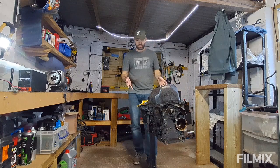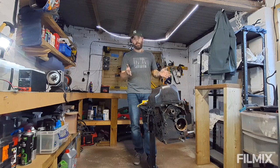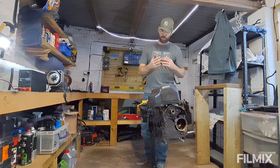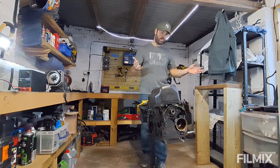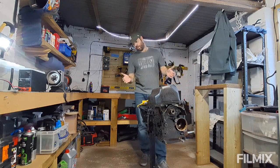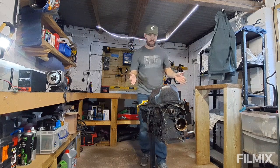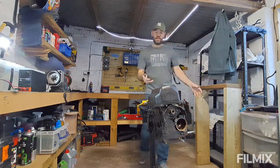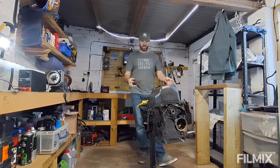Today's episode is purely going to focus on getting the block back on the stand. Obviously I'll need to strip all this down — take the sump off, take the oil pump and everything out, take the seals off, strip all the pistons and rods out. Basically we'll have a naked block very shortly. Then we're going to send the block away and it's going to be machined and cleaned and painted, and then we'll bring it back and put it on the stand ready for rebuild.